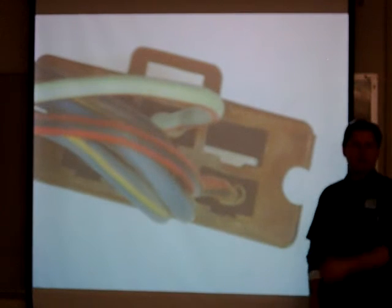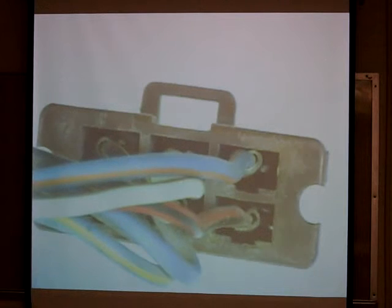Then I should be able to go back in here. I've got to make sure you guys can see the shape here. You can see the channel here — does that make sense where the tab goes? Do you think anybody puts these in backwards? If I put it backwards, will it lock? I can take it in and out a dozen different times and it won't lock. When I put the connector back together and put the male into this female, it's going to shove right out. If I go the correct way — did you hear it lock? Now we're good and we're secure.